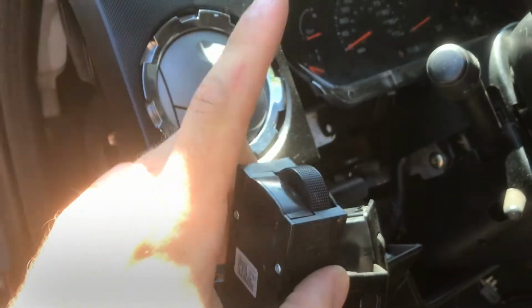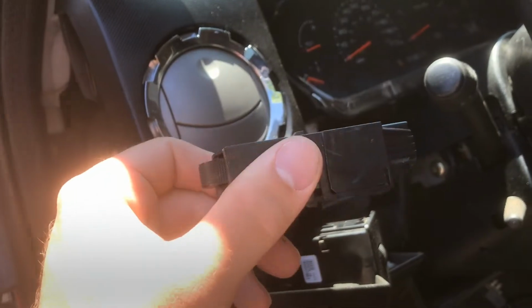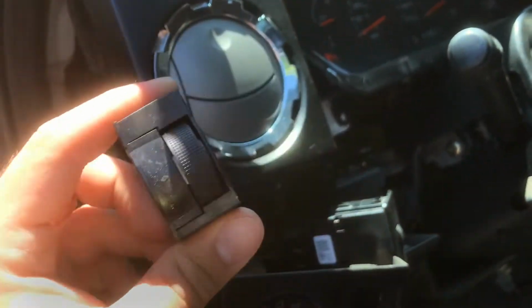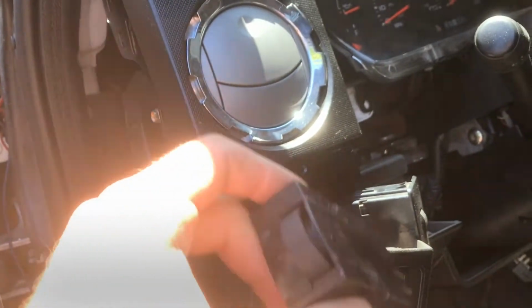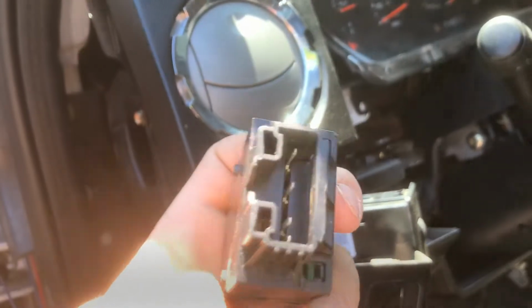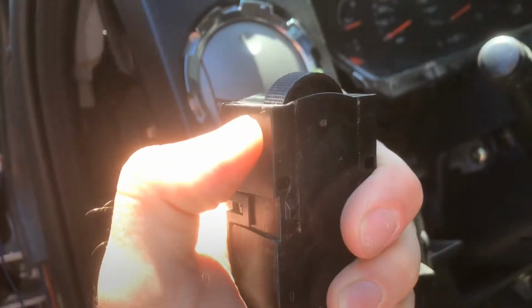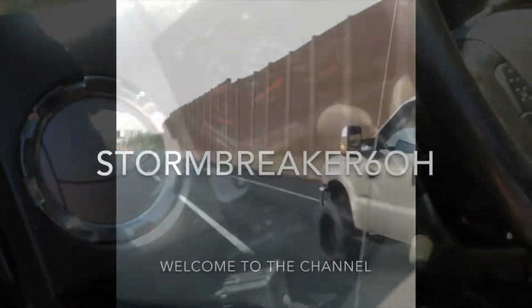No matter what I said in the rest of this video, listen to this. Do not use the 2008 to 2010 dimmer switch. It plugged right into my 2003 harness, but it caught on fire. Do not use it. It burns up. It can't handle whatever the old stuff is putting into it. Don't use the 2008 to 10 dimmer switch.